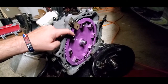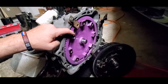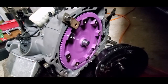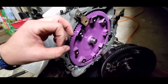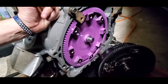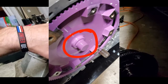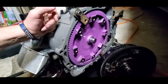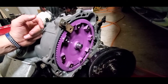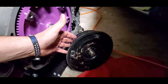I had bought eight bolts from the dealer just for when this day came. When I got the converter, there was paint all around the pads, so I went ahead and took a drill with a cup-shaped wire wheel and cleaned it off. I didn't want any uneven wear from sanding, and this did a pretty good job making sure I didn't have any paint on any of the pads. That original converter was limiting me to about 3,500 RPM even with the nitrous.